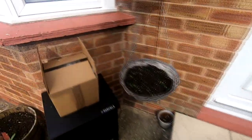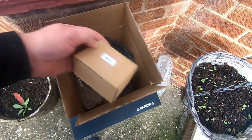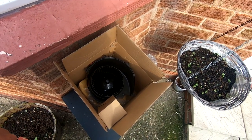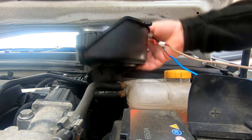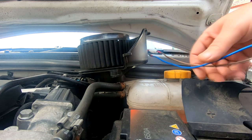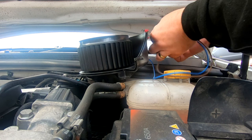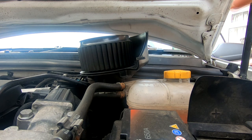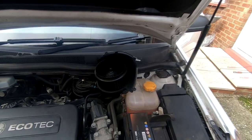A couple of days later and the package has just arrived — in the box is a new motor and it looks like a new resistor as well, which is what I ordered. Let me get the bonnet up — I'm just going to test this motor on the battery to make sure it spins and confirm the other one was broken. So now I've got the new motor mounted just in here so it doesn't shoot off, because it will spin quite violently if it works — just going to pulse it. It's exactly the same wiring harness as before, just wired direct to the motor. Onto the negative, onto the positive — just a quick pulse. That motor's good! So when you test your old motor and it doesn't spin when you hardwire it, then that's definitely your motor that's the problem and not your resistor.